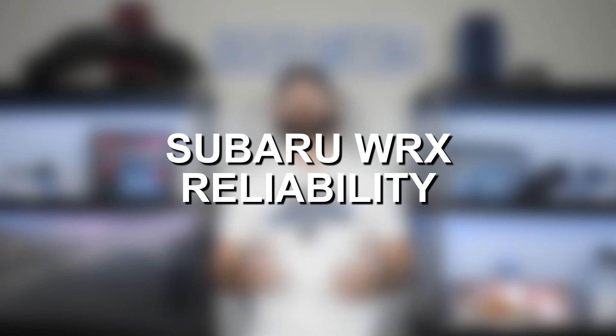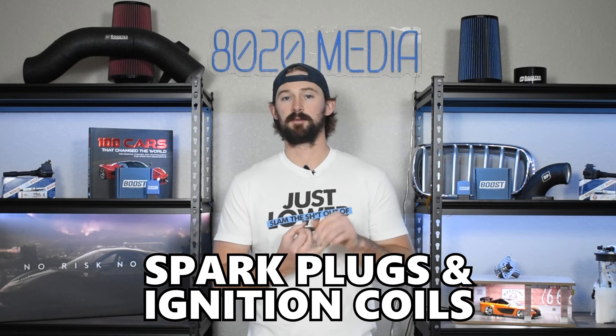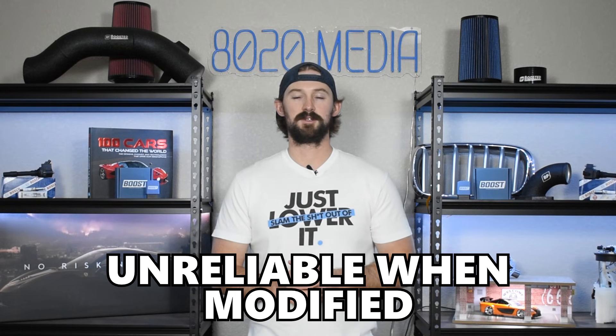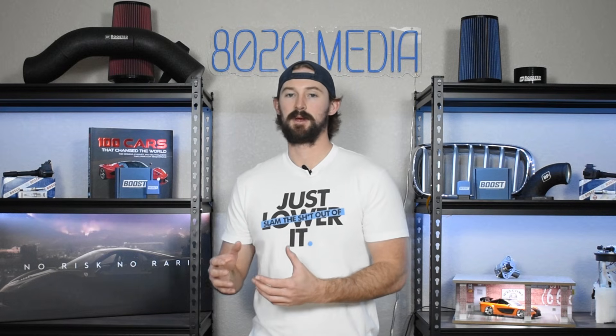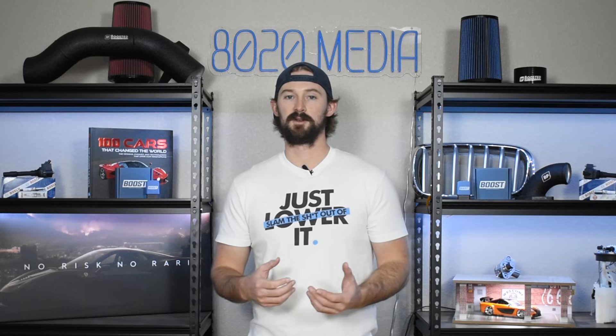At the end of the day, these cars and engines are both reliable and unreliable at the same time. They are reliable in stock form — you're likely not going to run into any issues with internal failures in a completely stock setup, but you still will have some higher maintenance-related costs and things to keep an eye out for, like oil leaks, your spark plugs and ignition coils, your turbocharger, as well as your fueling system. They are unreliable once we start talking about adding modifications to them. They have a relatively small window of where you can add power, but you can't add too much — just some basic bolt-on modifications and tuning can easily push these engines beyond their power capacity, which is why I stress the importance of proper tuning for these engines.